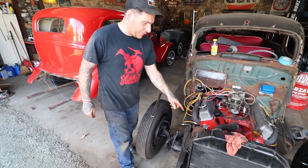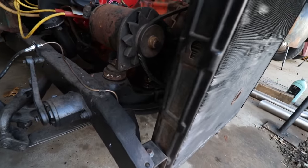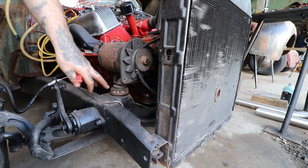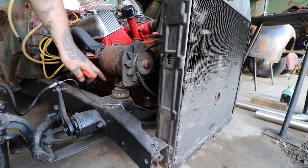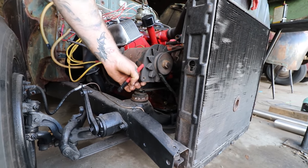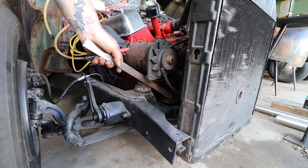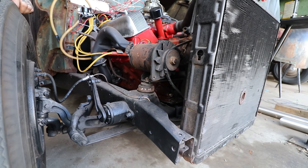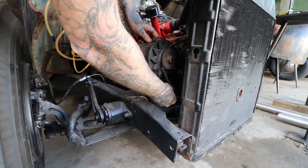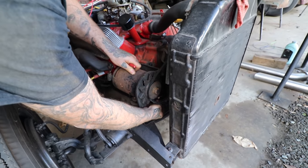We've got to make a generator mount for this just on the ear here. The way it used to sit, it used to sit a lot lower on the T-Bird, so the bracket that was on it didn't work. We have this mount that's in the way, so we're going to run it right about there - it's pretty tight on the belt I found. I'm going to be running off of this lower motor mount here, but it's too far in, so we need to Z the bracket out or bend it out. A lot of times I use 1/16th TIG rod and just roughly bend it where it needs to be.